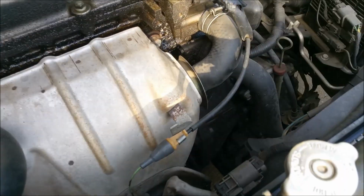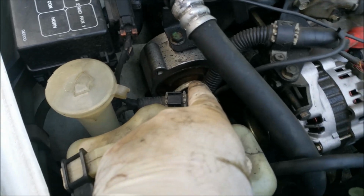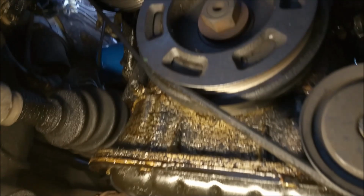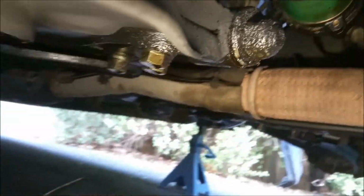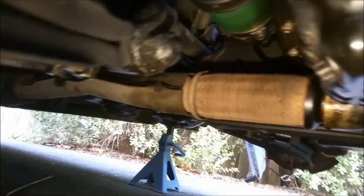The other thing is, the oil is going to create havoc with the mounts. They don't feel good. It's actually a physically huge engine compared to the Starlet. If you look at it, it's a litre bigger. We have to look at that top mount. When we get down here, it really does look quite ugly. All those belts will have to be done. But those control arm bushes, they're oil soaked, and there's actually drips of oil coming off things. I would be inclined to rebush those.